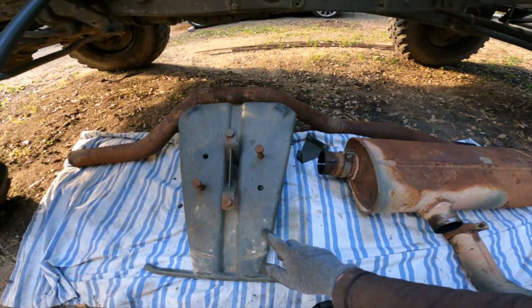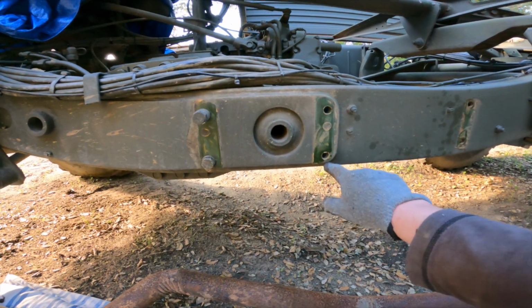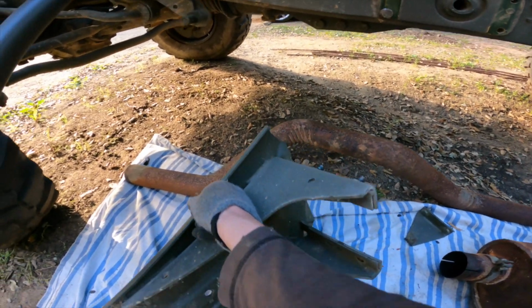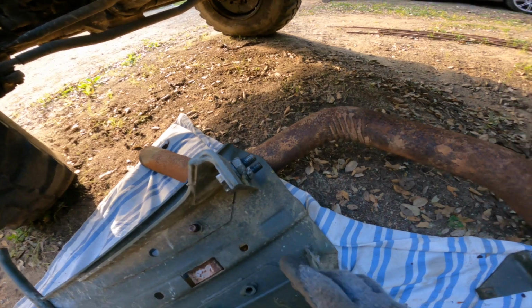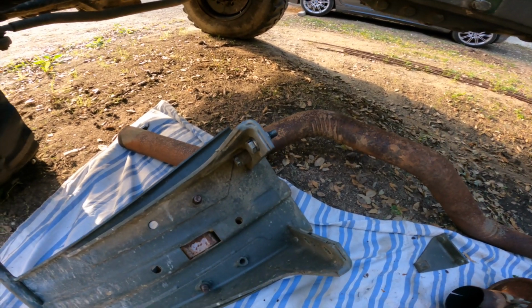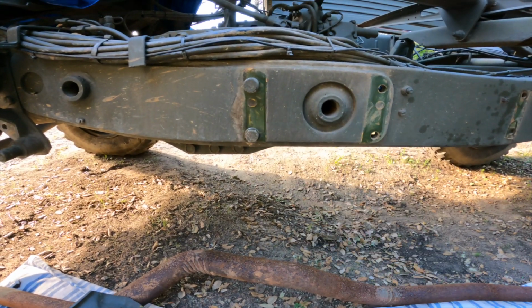Then the spare wheel carrier, quite a hefty thing. It was fastened here. These ones have nuts on the back, so if I turn this over, you will see that the nuts and bolts are back on there, and they are 22, not 24. Yeah, let's not talk about that anymore. And these ones have captive nuts on the back, so you can just buzz them out.